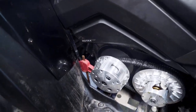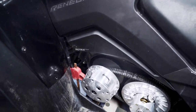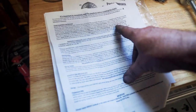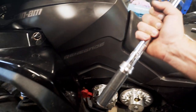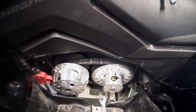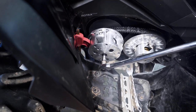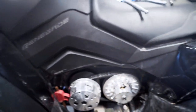We've got the primary bolt back in, now it's time to torque it. Always make sure you know the torque spec. Use STM Supply number 13 bolt with lock washer, 10mm hex head. We're going to torque the bolt to 80 foot-pounds. Set the torque wrench to 80. Already got the clamp on there. Torque her home — bang on 80. She clicked. Everybody's happy.